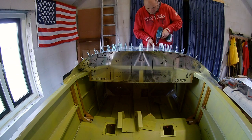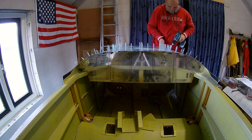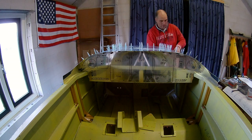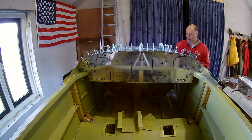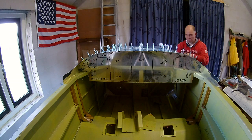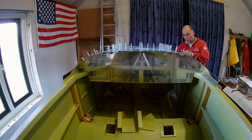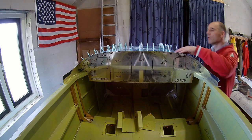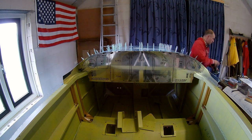You have to be very careful when you drill the holes through the firewall. Mainly because it's steel and as soon as you drill it it's very sharp. You have to deburr it almost immediately because if you don't you'll really cut your hands very fast. And again, of course, I did it again — somehow I always end up bleeding from my hands.